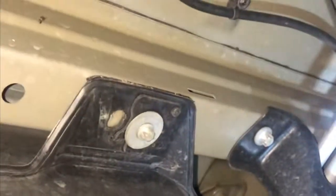I thought I was going to be able to lower the gas tank just a little bit and reach my hand in there. The EVAP sensor should be on this side and the fuel pump on the other side. I got the crossmember and pan off. There are five bolts that hold the gas tank. I got the jack underneath the gas tank, we're going to remove those bolts and lower it.